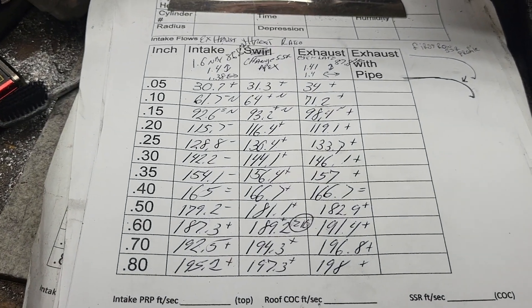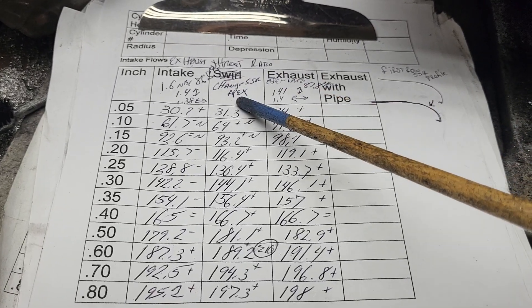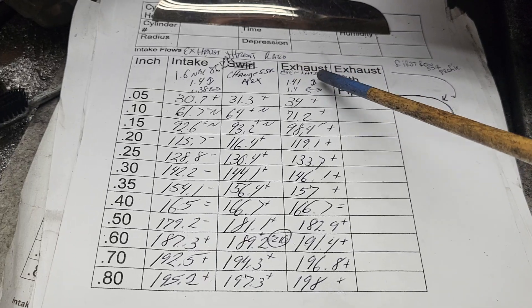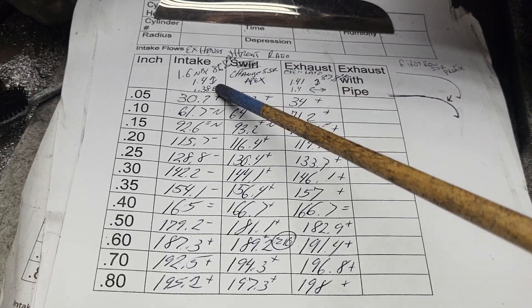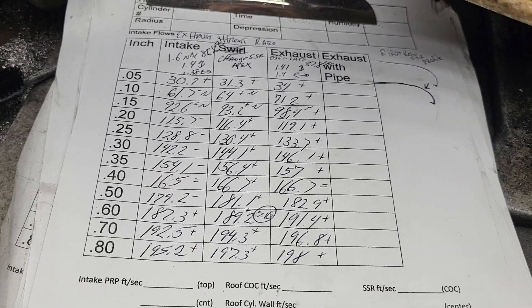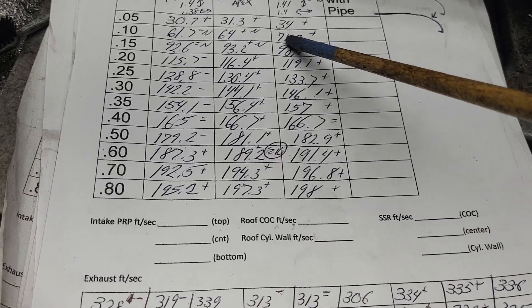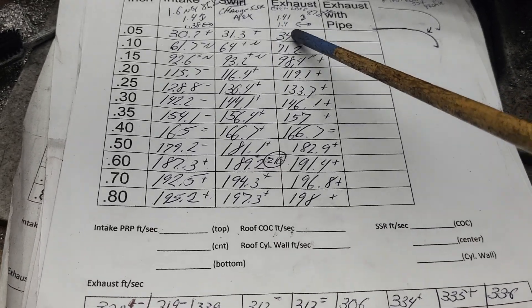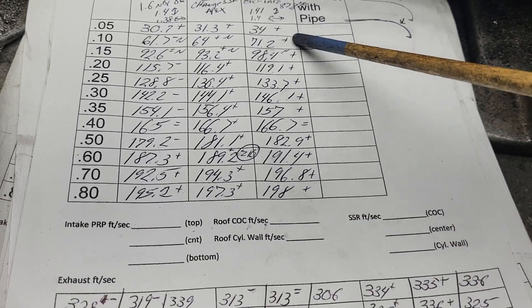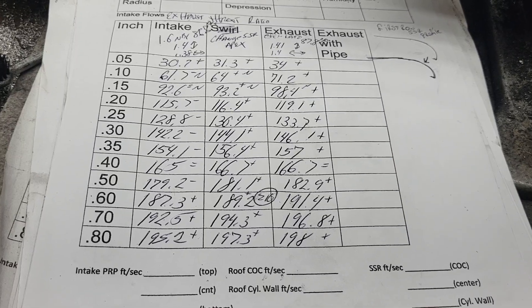As far as our curves go, I changed our short side radius apex — that has not been touched, so that's still the same, except it's got a little more throat area. We went from 86.8 to 87.8 — literally one percent — but that equals some gains. These are pretty good gains, not bad at all. It's almost 88, that works out nice. Let's take a look at the airspeed, see if the airspeeds are as good.